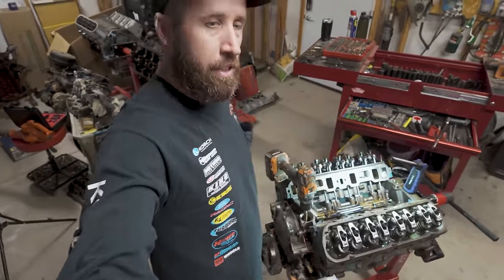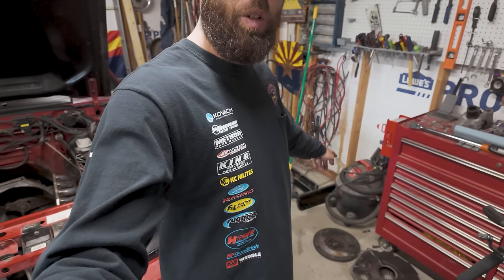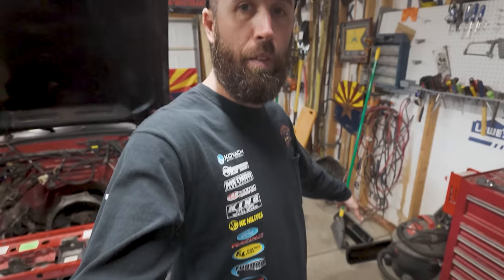I'm gonna start throwing all these accessories on. Start cleaning up the intake manifold. It's all ready to get thrown back on. However, I wanna hit it with some brake clean and scuff the actual surface underneath. And I need to get some pads for that, some brake clean for that as well. And then we'll get on these valve covers over here, which might have to be modified to fit these rockers. I'll touch on that as well. I also need to get bolts and nuts for those valve covers. So we're gonna go get that right now.